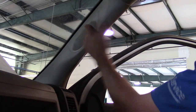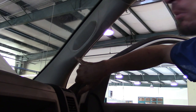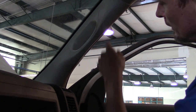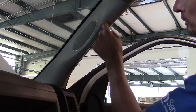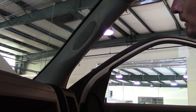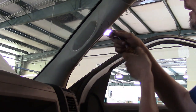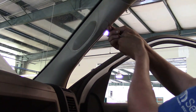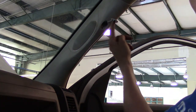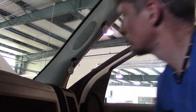Another duplicate item we have is these grab handles. The grab handles have two 10mm bolts up in here, but they've got plastic access covers hiding them so you can't see the bolts. Getting a plastic trim stick in here is kind of hard because there's almost no clearance around the cap — you almost have to use a small screwdriver. You need to be careful because there's almost no way to not mar it up a little bit. Just try your best, don't pry a lot or dig too much. I try to get an edge and pop it the best I can. Do the same thing down here, and now I can get to these two 10s.